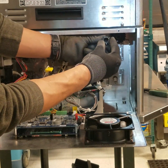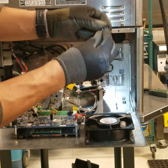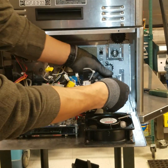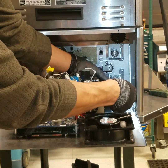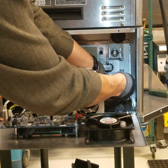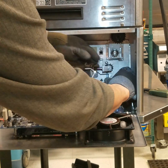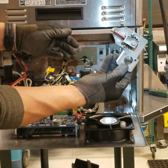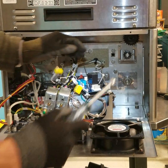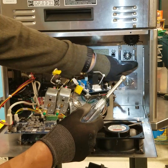With the lower sprocket removed, be careful not to lose the set screw. Carefully set aside. Use an 11/32 nut driver and remove the lower 3 hex nuts. Remove the spring tensioner completely from the toaster and set aside. Use an 11/32 nut driver and remove the 4 outer hex nuts.